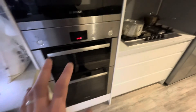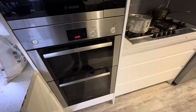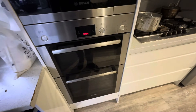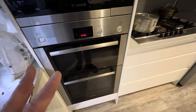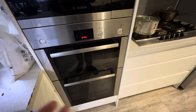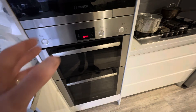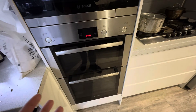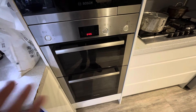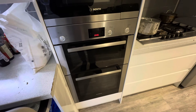There's no spur or anything isolated at the microwave, so the plug is probably buried behind somewhere and it's very difficult to get to. Same with ovens as well — single ovens are okay, but this is a double oven, and that's going to weigh an absolute ton. You should be checking behind ovens because some have plugs, some don't, some are hardwired. You have to make a judgment call on that. Don't go overexerting yourself and risking injury just for the sake of pulling out an appliance. Note it on your paperwork, say to your landlord or client you can't do the oven on this occasion because of the weight, you don't want to damage their kitchen, and perhaps arrange another time to come in when there are two of you and you can pull it out if the landlord deems it necessary.